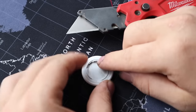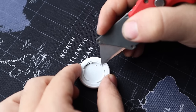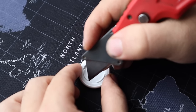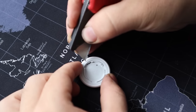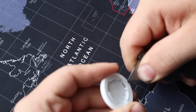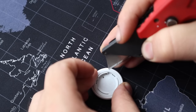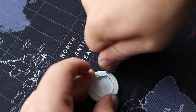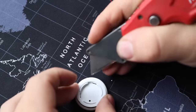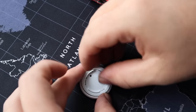We need to know the position of the clips — there are three clips on here. There is one where this gap is, one right here in the middle, and another one at the bottom. So get your knife in there, it shouldn't be too hard, then pry back and you could hear it click. Now the next side is right around here — you might be tempted to just pull this out but don't do that. Go to the bottom, put your knife in here, pry back, and this can come out now.